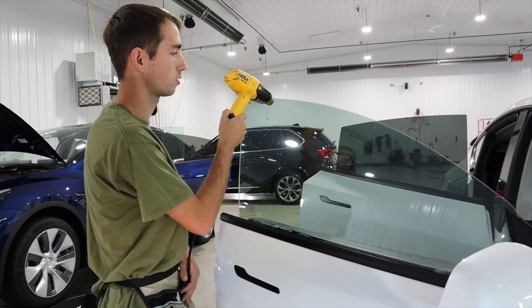When you're heating it up, it should be pretty warm to the touch, not hot. If you grab the glass and you have to pull your hand away quickly, that's a good place to stop — if you go any further you'll potentially damage the glass. I'm in a good spot there. Grab your hard card and a towel — we put a towel on the hard card just to help limit potential scratching — and just go through the top edge to get any little bit of water out. Just get it warm, past room temperature warm, but not hot.